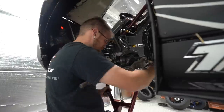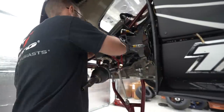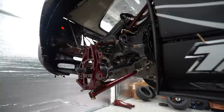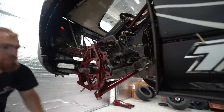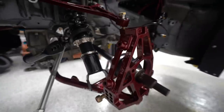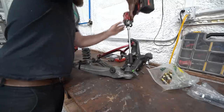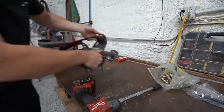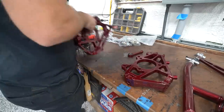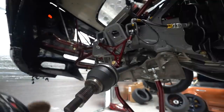If you have two sides to deal with, always complete one side before tearing apart the other — that way if it doesn't fit you only have one side to put back together. I also didn't want to strip the old suspension first because we don't have a stock Corvette driveline, and I wanted to make sure this kit would work with our axles and diff setup. Fortunately it all fits — the axle is in its window and everything's good to go. So we strip the stock suspension, save the wheel bearing hub assembly, and swap that into the new knuckle.